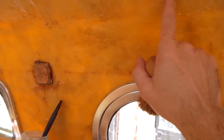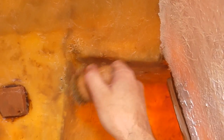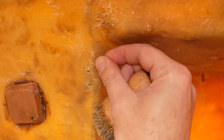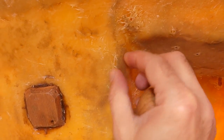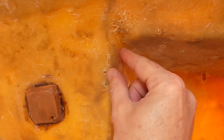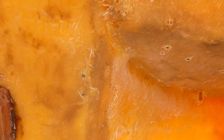The wire brush got the rest off and that's cleaned up pretty well. There are little bits left behind in some places, and you can see the glue has stayed gluey — you can sort of peel it with your fingers but you can't brush it off. What I'm going to do on those little patches is apply some paint thinner, which I found gets rid of the glue, so I've got to go around and dab paint thinner on the patches where the glue hasn't gone away.